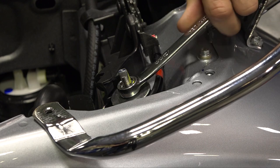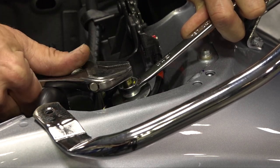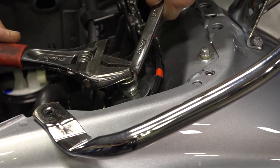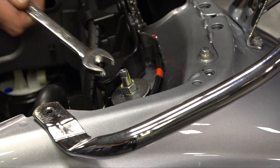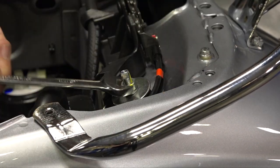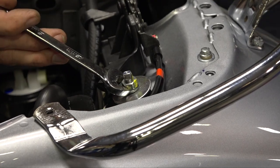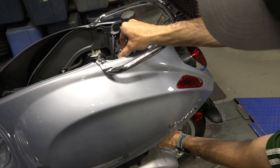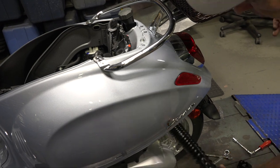The upper shock bolt has a nut that needs a 13mm wrench. You won't be able to turn it because it's rubber-mounted. Use an adjustable wrench or vice grip on the flat at the top of the shock shaft — be careful not to distort the threads at the top. Once you get the nut loose, it goes pretty smooth from there. There will be a lock washer underneath and the shock will want to drop down, so get your hand under the scooter ready to catch it. Use a socket to pull the nut off, then remove the split washer, flat washer, rubber bushing, and pull the rear shock out.